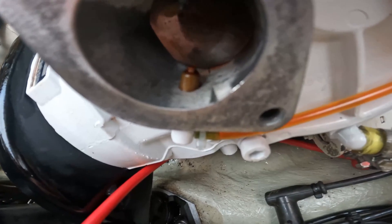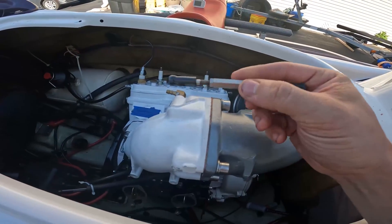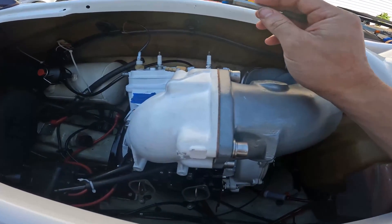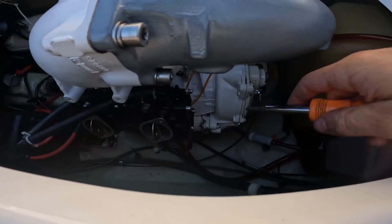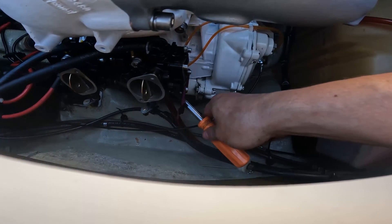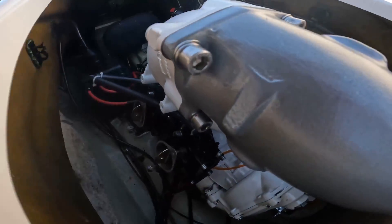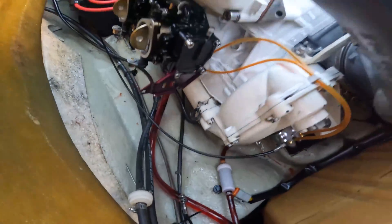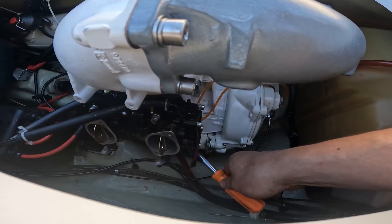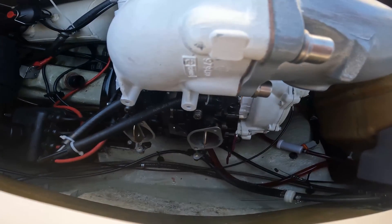These are dual carbs so they will have a carb linkage bracket. This carb linkage is very important — it basically syncs up the butterfly so that they are opening at the same position. So before we put the carb linkage cable on, we need to take our idle and turn it out as far as we can go. There is a little window right here on this rack and that is where you stick your screwdriver through to access your idle screw. You can also get your fingers around there because it's a T-handle, so we're basically going to turn this out — I already did it so it's already out — that means this butterfly here is flat and closed.